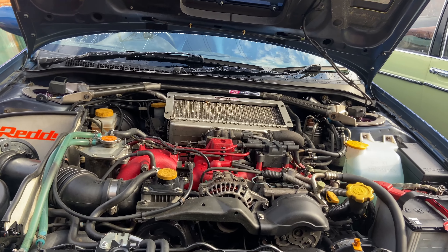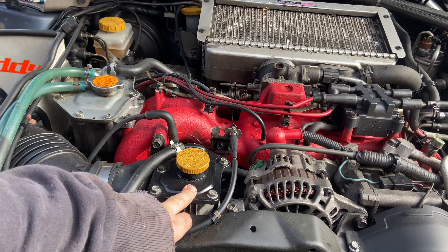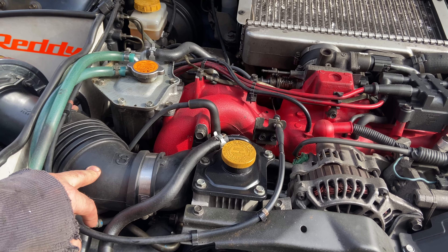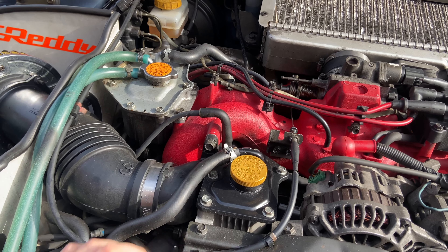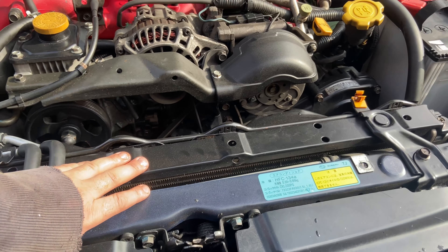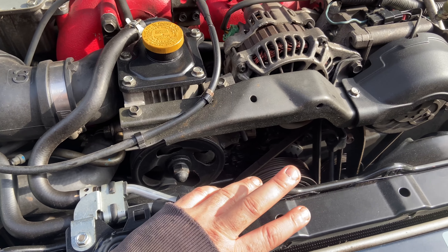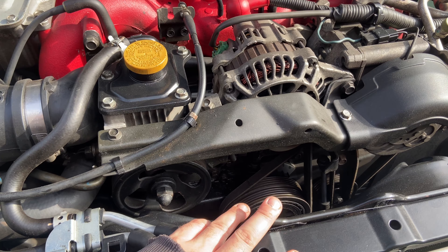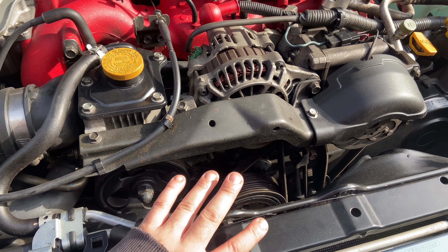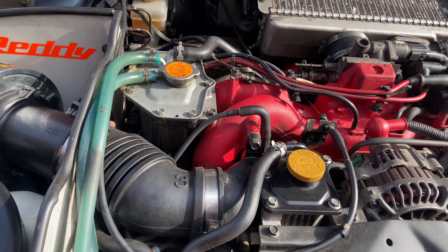We're doing the Scooby — this has just had an engine built. It's an EJ207 which comes in the late Version 6s. This is actually a brand new crate engine, EJ207, identical except for one breather. It's got Version 6 heads which have been reworked — nothing fancy, just new seals and guides. We put a really nice inlet plenum on because the old one had flaky paint. We powder coated all the radiator shrouds and cowls, fitted a new timing belt kit, and Roger Clark Stopper head gaskets — the Extreme, not the Extreme Pro. These are just normal Extreme, good enough for what we're doing. We're not running big power — it's literally standard power on this car, built with good parts.